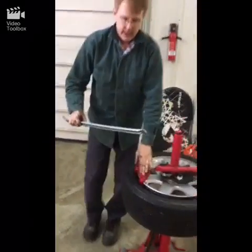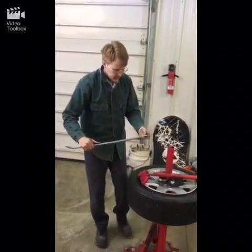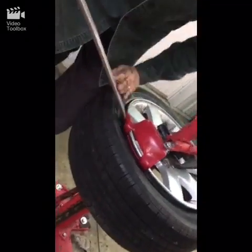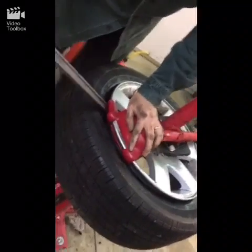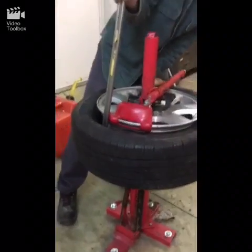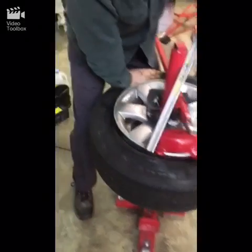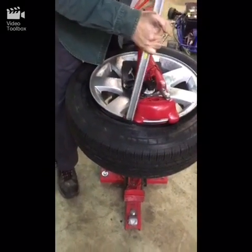You take this tool and you're not going to touch the rim. There's a little ridge right here made to go underneath. Move this into the center so you can get it down. Now to get this to wedge over, you'll usually have to move your rim over the drop center. Move this up like this, move this down some, and get it to come over the top.